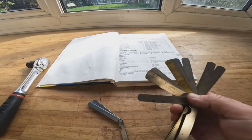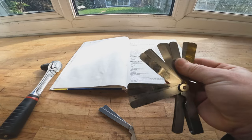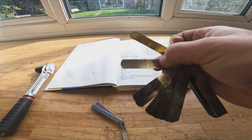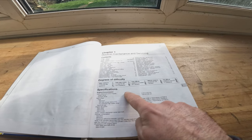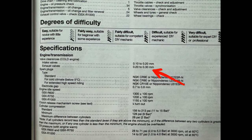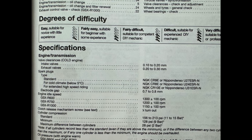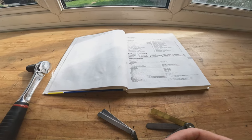These are the tools you're going to need to actually measure the valve clearance — feeler gauges. They're basically thin strips of metal in different sizes that we can use to gauge that clearance. You need to be careful when selecting these because some have the reading in millimetres, some are in inches, and some display both. Always make sure you're reading the right scale. We also need technical information to find the exact valve clearance specification. The specifications for these clearances are 0.1 to 0.2mm for the intake and 0.2 to 0.3mm for the exhaust. Always remember to check your valve clearances when the engine is cold. The exhaust clearance will always be bigger because of thermal expansion — they get hotter, so they need a larger clearance. It's also good practice to draw a little diagram to note down what you've checked, what's good, and what's not.